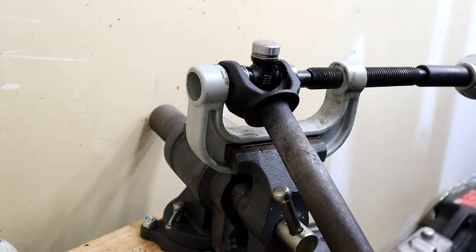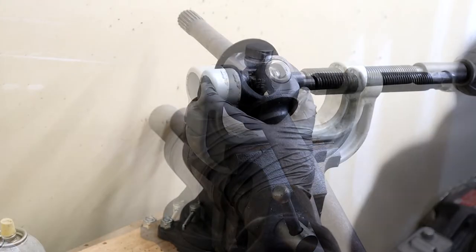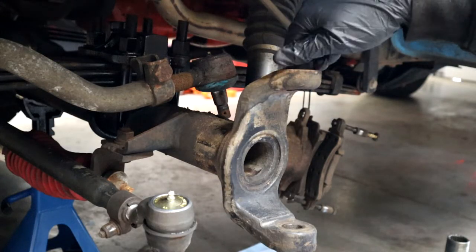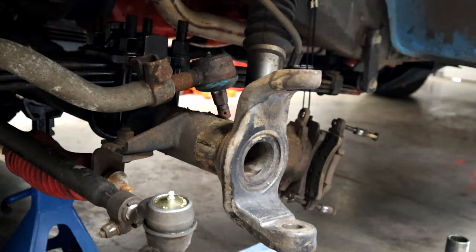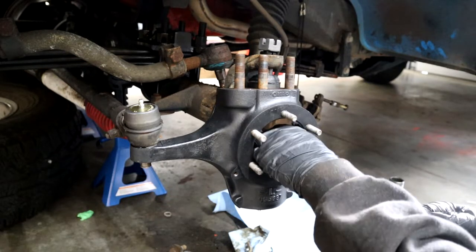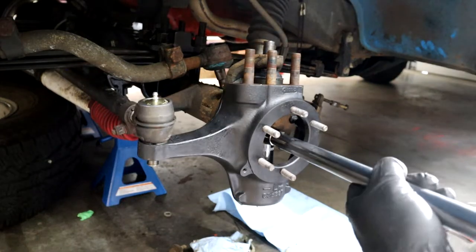Same thing with the axle shaft U-joints — I cleaned up the portions, shot some paint on them, gave a little sanding to the inside of the U-joint areas, and did that on the ball joints as well. Then just press them in, put the C-clips in, and you're good to go. I had a heck of a time finding the part number for the seal that goes on the base of the inner axle shaft — that'll be in the description. It's not exactly the same as what I took off because I think it's from a '73 but it looks like a better design. I didn't change the inner axle bearings on my passenger side since it looked good, but I had to change the driver's side because all the needle bearings were shot. The seals I mentioned actually came with the inner spindle bearing so I was able to change that out on the driver's side.